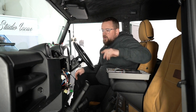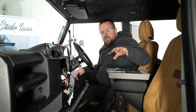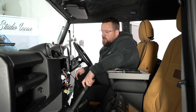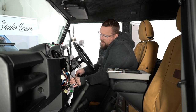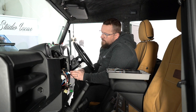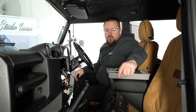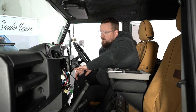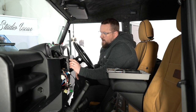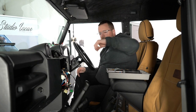Got some standard tools, so what I'm going to do now, I'm going to speed you up, because I am going to fit the DAB conversion and things like that, that this unit won't use because it's not a DAB unit, but just so that when it comes around to swapping the units, we're pretty much straight up swapping. So I've got the button relocation panel in. I've had to plastic weld a new bracket onto the back of that to get over the cutout that we discussed earlier on, and that's now sitting in there really well. Modified the USB plug so that now works from the Sony, although the 1000 doesn't have USB on the back, as USB on the front, so at the moment that'll be redundant until the new deck. And then the OBD reader is in this mount that you can move around, wiggle from left to right, and you can take off, put it back on, so that worked out quite well. So yeah, speed you up and off we go.